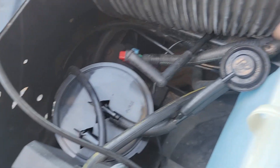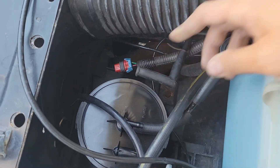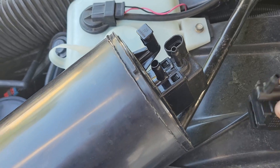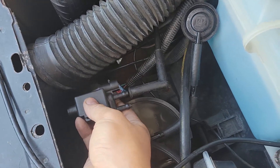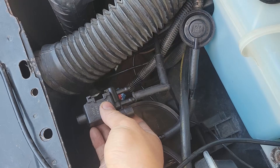I connected the line from the tank pressure control valve to the bottom port on the canister. The hose to the throttle body went to the top port of the original purge solenoid — that should be this port on the new one, so it should sit like this. I was originally going to do it like this, but then I would have hoses crossing each other.